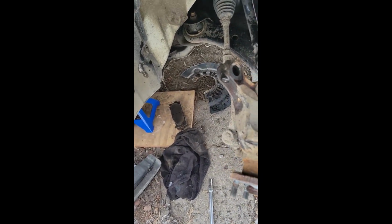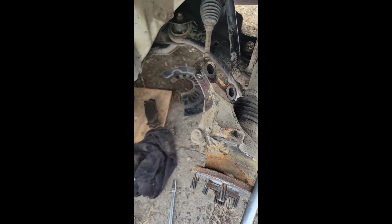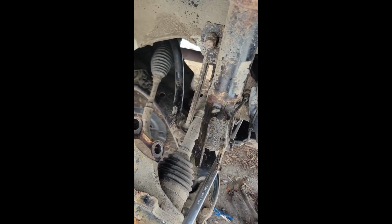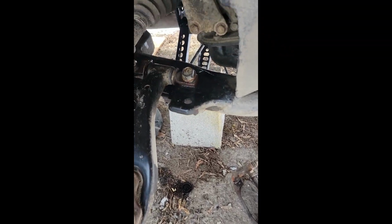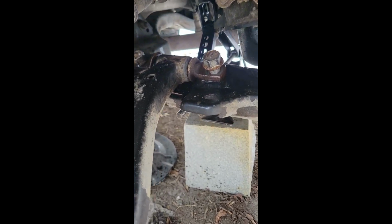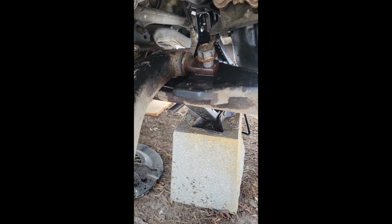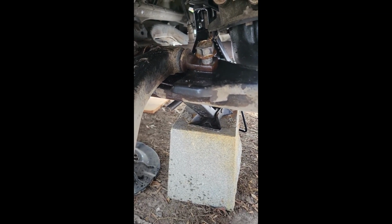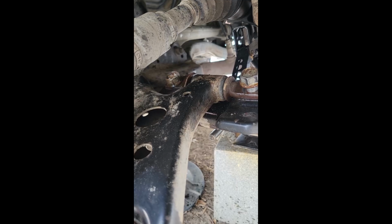And in the same fashion on this side, I'll throw the hub knuckle on that end, the edge, and have more access this way than this bolt over here. I cleaned off the dirt, and I sprayed a little liquid wrench in there so that the threads would have a little less friction coming out, and that seems to have helped a little, but it's still coming out hard. Still yet to work on the other one.